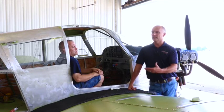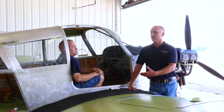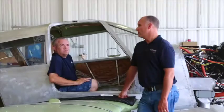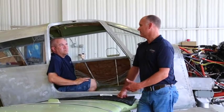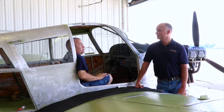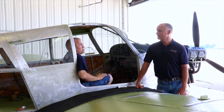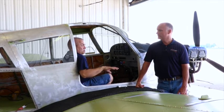On this one, besides the wiring, we also addressed some maintenance issues — control cables and things like that. Then we start with a new panel. We actually took the whole panel out and are going with a whole new solid panel. When doing a new panel installation, once we get the layout from the customer, we use a machine called Panel Pro to draw it up. It gives the dimensions of all the equipment and instruments. We get a rough draft, get customer approval, then get a piece of aluminum, lay it out, and the machine cuts it all for us. We've totally taken out the existing substructure, just leaving the support brackets, and the whole new panel goes right over the top.